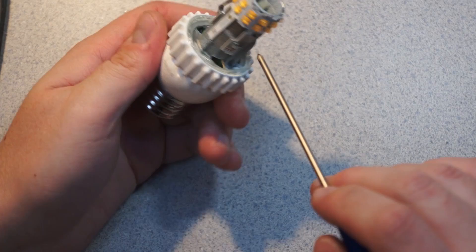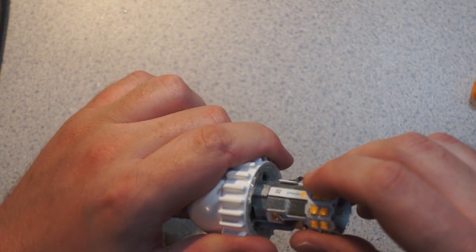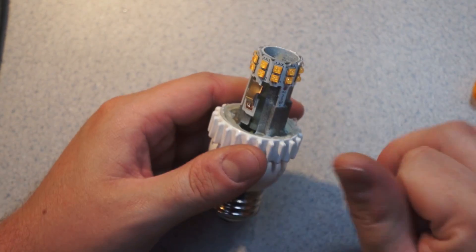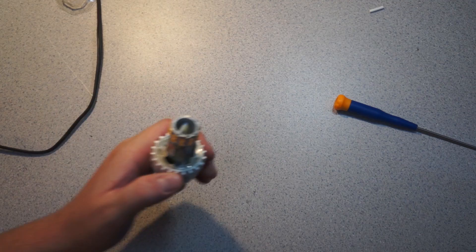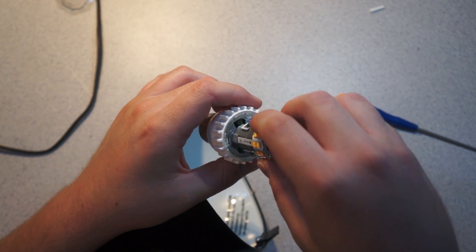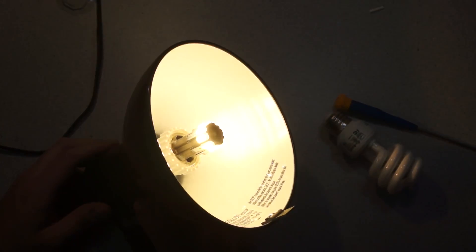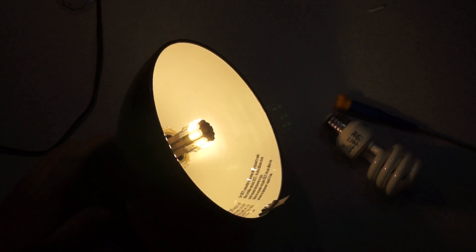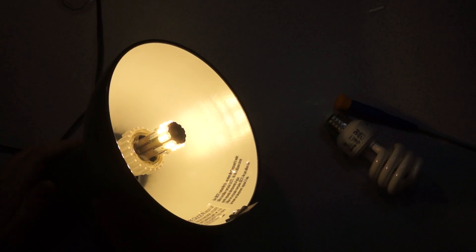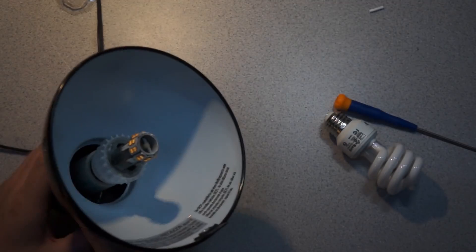You can see here are the two connections. I'm not sure if these are in series-parallel or just straight up series. It's interesting - I didn't know they could route out the backside of boards like this to make them fold, but I guess it makes sense. So this I would worry about it not being isolated from the mains - you have to be a little careful. But that's quite nicely bright. The white balance is a little off because of the bench lighting. It has a yellowish tint, more of a warm tint. Seems to work pretty well.